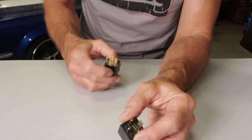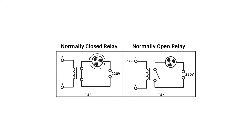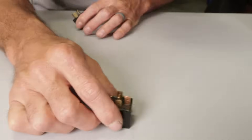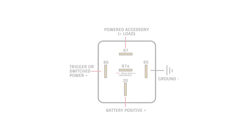The most common relays found in the automotive industry are the four and five terminal relays. The four terminal relay, known as a single throw or sometimes even a make or break relay, has a normally open contact, but they can also come in a normally closed design as well. The five terminal relay, often called a double throw or changeover relay, is typically used for accessories with reversible motors, like your power windows and maybe some trunk release designs.